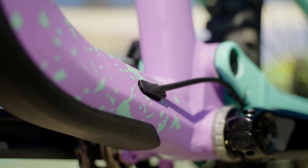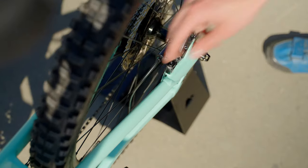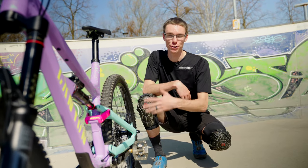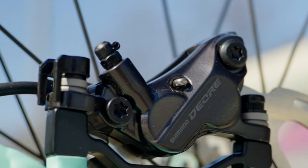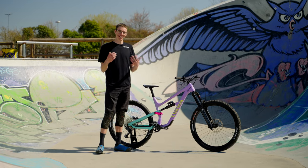When you see them advertising silent, you expect silence. The cables on the rear triangle are held on with zip ties to the chainstay, and for the derailleur the cable seems like it's hanging a foot off the bike. I'm honestly worried it might get caught on something, and even if you shorten the cable it's still hanging out there. Then there's the brake hose - because it's only attached by zip ties, I've already fixed this issue twice. The hose is literally hitting the wheel as it spins and there's no way to properly secure it to the frame. Also, the Deore brakes come with a cotter pin to hold the pads into the caliper - I can't imagine it costs Shimano that much more to just put some threads in there with a proper bolt.